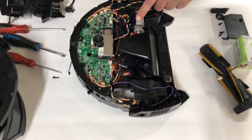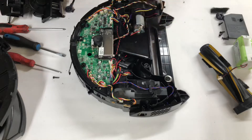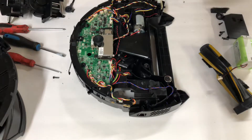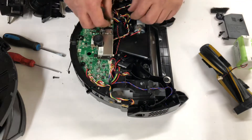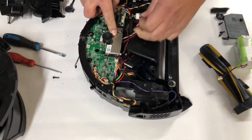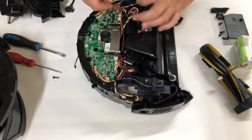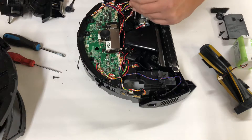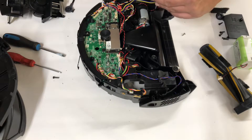So those are two things you can replace. To replace the main brush roller motor, cut the wires, pull it out, and just drape the new wire over the suction motor — it makes it a lot faster if you know that's the issue. Uninstalling the components in this robot are very simple, so go ahead and just pull out a few wires so you can get to that screw right there. We're going to undo this Phillips head right here, and this Phillips head right here.